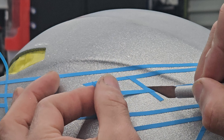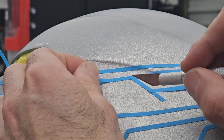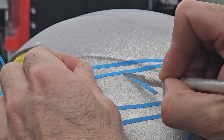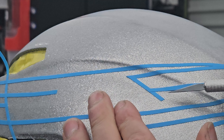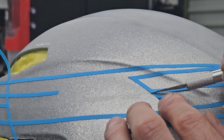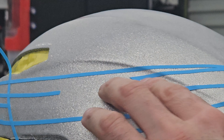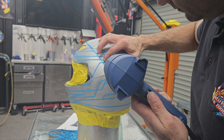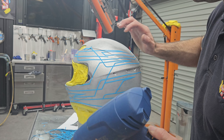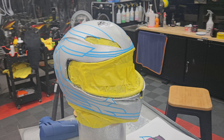One way to get nice sharp edges using tape is to use the angles of the tape. This is a 3mm fine line tape. If I lay the tape over and then run another piece of tape on an angle, that can create a sharp edge. By following the line, I can get a nice pointy finish. There might be better ways, but this is how I do it. You do have to be careful not to damage that clear coat too much with the knife — just apply enough pressure to cut the tape and not damage the clear too much. A heat gun can also help get the angles and get those curves laying down nice and flat to the surface.